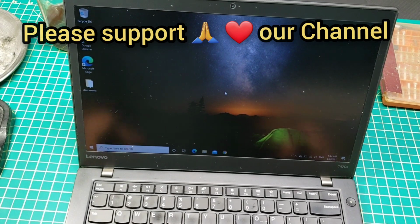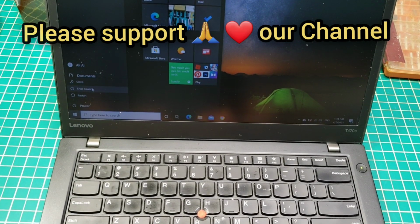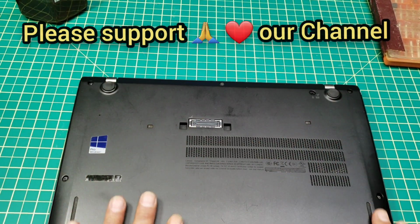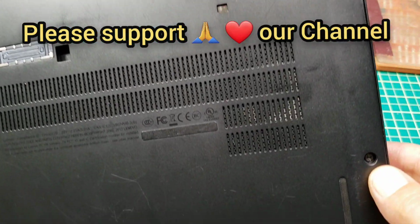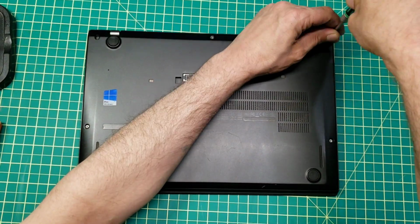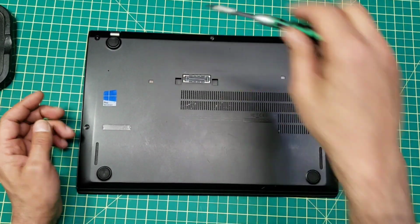First of all, I'll see what happens when I unplug it. Basically, it tells me to plug the cable back in, but it's not charging. So I'm going to have to turn off the computer. Now we need to remove those covers. There are screws here, 1, 2, 3, 4. This is like a lock for something, I don't know. Okay, this is another screw. A flat screwdriver like this should work. Five. So here, I think it's nice.